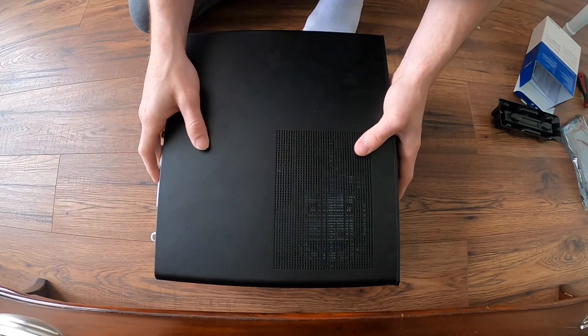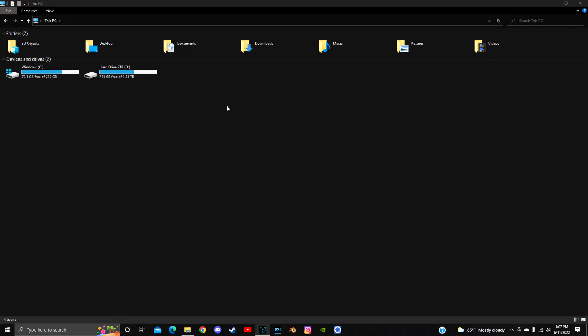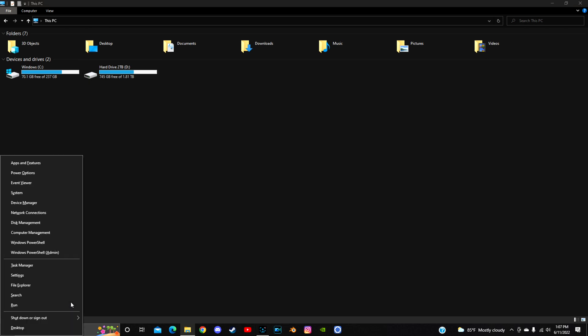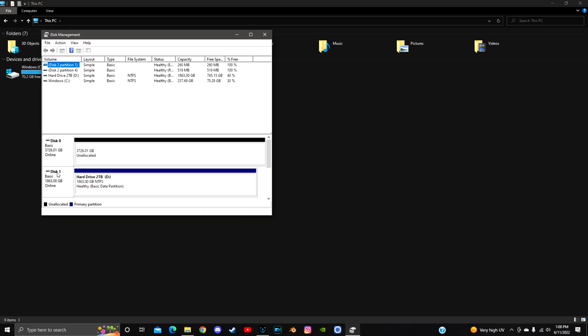Now we can plug the PC back up and set up the hard drive. On the computer, you can see that your new hard drive doesn't pop up automatically. This is my hard drive that I already had — I started filling up way too much space so I needed to add another one. To get your new hard drive added, press the Windows key plus X and come down and click Disk Management. All your disks will pop up here — this is the one my PC came with, this is my two terabyte, and up here this shows my four terabyte hard drive.